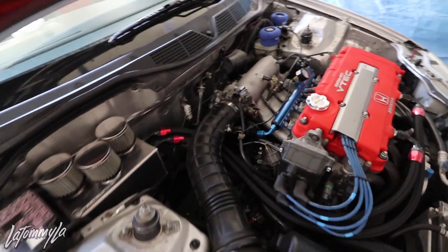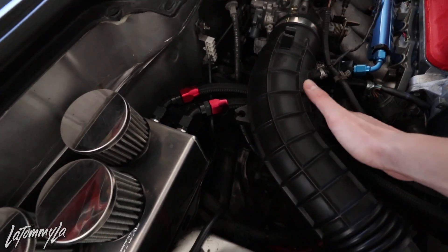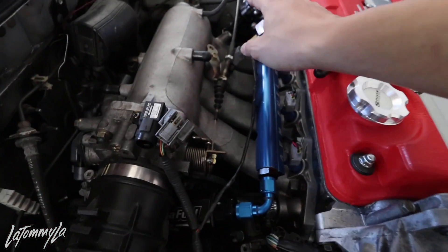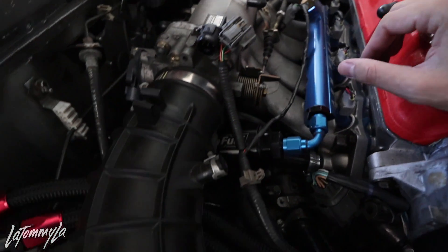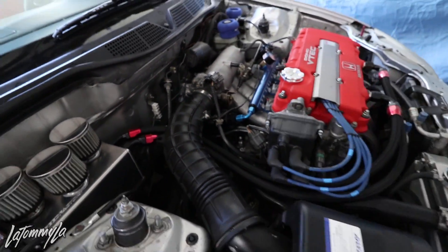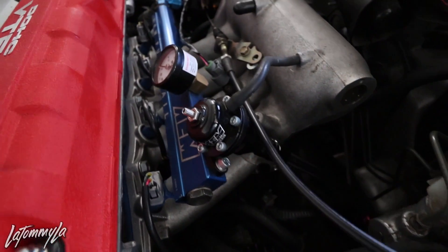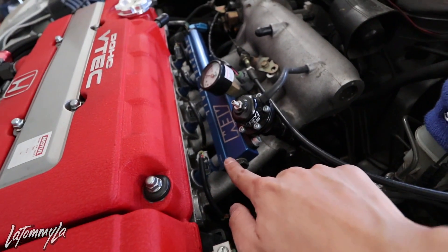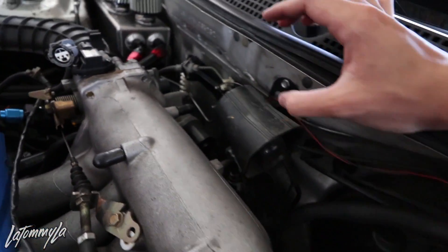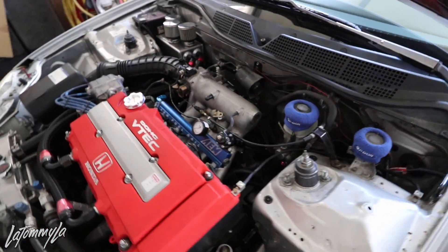A little bit more light here. I'm gonna start off by taking off the intake arm, get the catch can out of the way, unplug all the injectors, and take off all the sensors. My filter is on here so I'll just move it out of the way — there's an AN line so I'll just flex it or bend it. Then there's the fuel return line. Once the whole intake manifold falls off, I'll switch over the injectors and fuel pressure regulator, reroute the vacuum lines from the bottom ITBs up to the vacuum block.